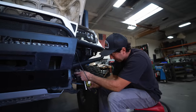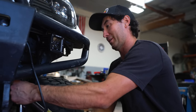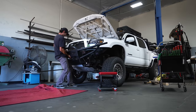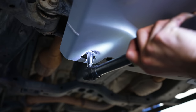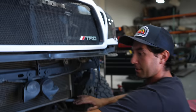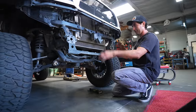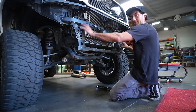We're going to get this bumper off and figure out what we want to keep as far as clearance for the frame. That's a big weight on the front. The biggest problem on Tacoma frames is this subframe right here - some people like to keep it since it holds everything together, but when we build the bumper we'll tie it all together so it's connected and keeps everything from flexing.